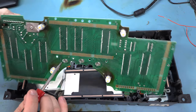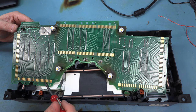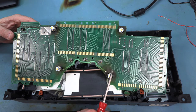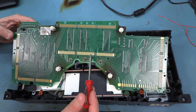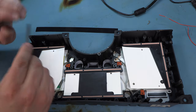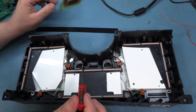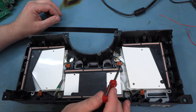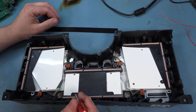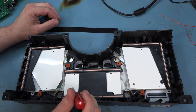The next job is cleaning these before putting it back together. I see no paint chips, no debris that would cause the few segments we saw not working to fail. So we're going to set this top board aside and move on to the next thing that can go wrong: dirt on these pink rubber blocks. On careful examination I don't see debris — well, maybe I do. I just brushed a little bit of debris away from one of those pink rubber blocks, and I see a little bit more here. So it is entirely possible that these pink rubber blocks aren't clean enough to conduct the small amount of electricity needed to turn on the LCD segments.